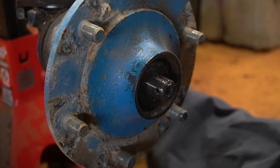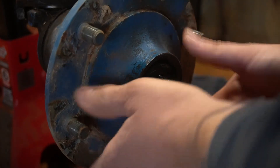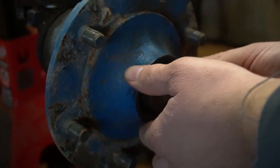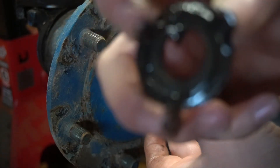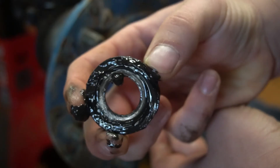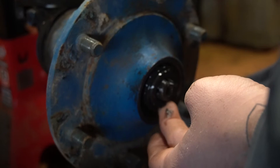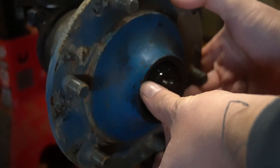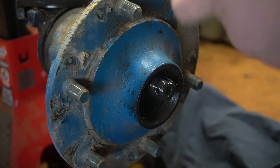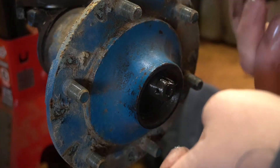Right now there's no need to get this nut overly clean, and I'll show you why in a second. Now in here, the first thing we're going to encounter is a washer with a notch in it. That notch is keyed to our spindle, so don't forget the washer when you put it back. The next thing is what they call the outer bearing — this little guy right here. This is actually a Timken bearing. I like Timken bearings — they're made in the USA, good quality bearing.